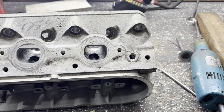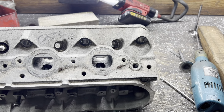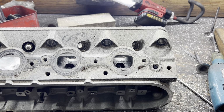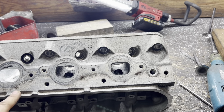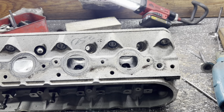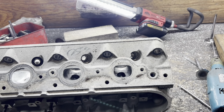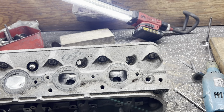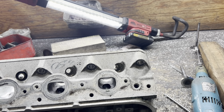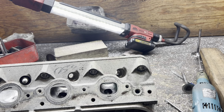What I'm doing right now, because one of my friends, another shop close by to me, bought a CNC machine, a Centroid. So I think I'm gonna digitize my stock valve port and one exhaust port as a stage 2, so I can do a rough cut with the CNC, and then I can tailor the port if I want to make it for a 2.05 valve, for a 1.6 valve. At least it's opened up.